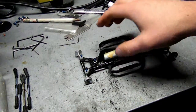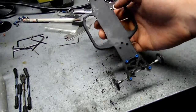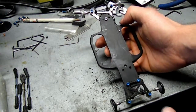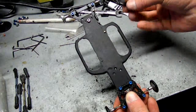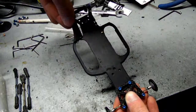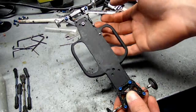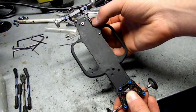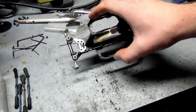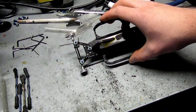Here it is all said and done. I've got a nice steering setup now. It's pretty simple — just a turnbuckle there. All I did was remove the two screws in front, shaved down the chassis a little bit to give more room and save a little weight. On this side I also shaved a little more away so I could access the turnbuckle with pliers with the body on. Altogether it probably took maybe a half hour, and now I have adjustable steering in the front.